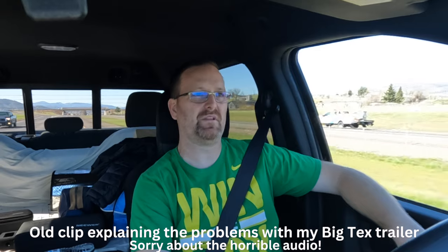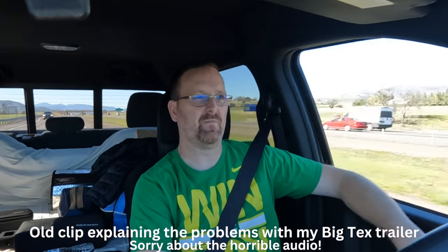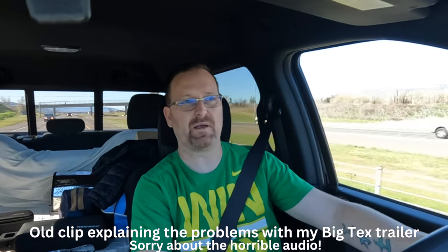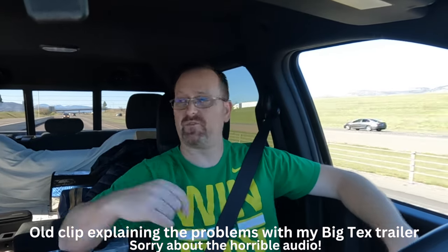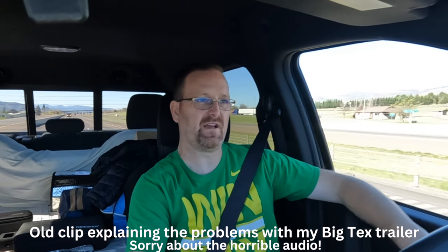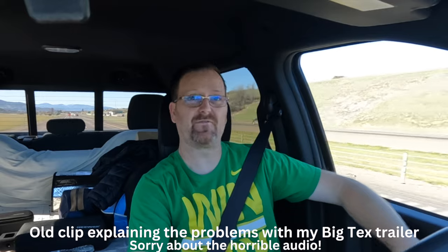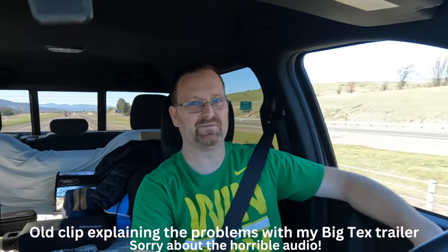Most likely I had to replace all four tires, and that's kind of a common thing unfortunately with Big Tex - their factory tires are not good tires. You're probably going to lose a tire, if not all of them. What happens is they're just complete junk tires - you're separating the tread off of them, and that's what happened to me. All four of them in the summertime, at separate times, the glue heated up, the tread separated from the tire and came right off, just like it would on a semi. I had to replace all four at separate times and went ahead and replaced the spare too, getting whatever 16-ply tire I could.